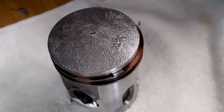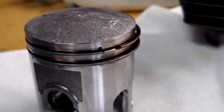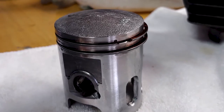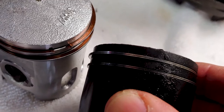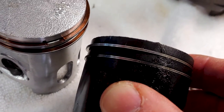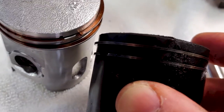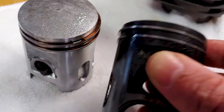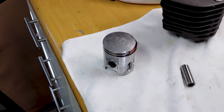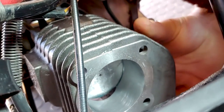The rings seem to work well. There's a coating on the outside — looks like some form of copper. The big difference from factory rings is that each factory ring is almost two rings combined — I'll show you. You can see the dual rings within one ring; I guess oil gets trapped between them. For the price of the Chinese — or at least Taiwanese — one, you can buy four of those.